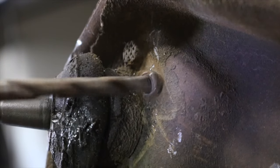Looks like my camber adjuster bolts for the lower suspension are at their maximum setting, moving the lower control arm in, which would account for some positive camber and a possible loss in caster.